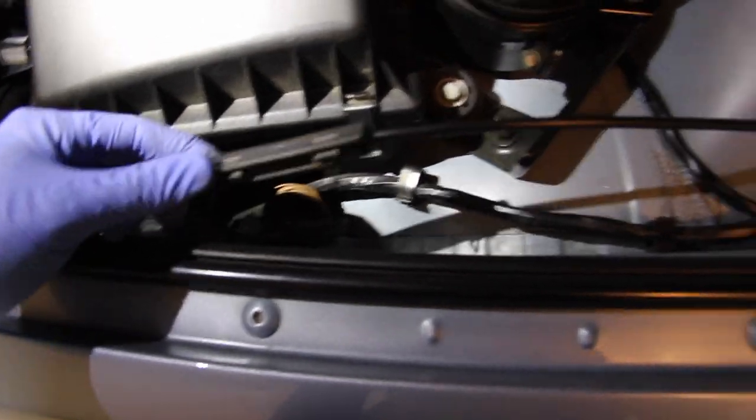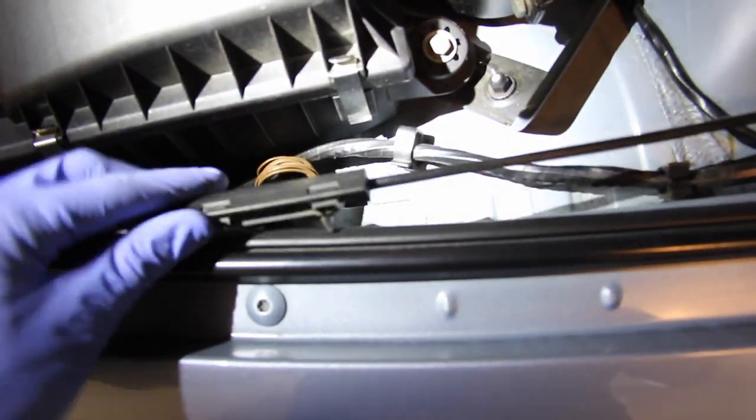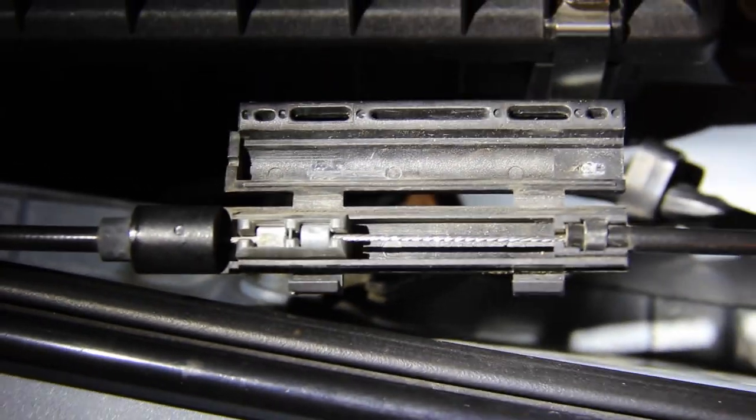Following the cable down, it pops into a clip — release it from the clip. This is the junction box; it's like a trap door that opens up and the two cables have a hammer on the end. If you're only replacing one cable, simply pull it out and release the hammer from the junction. We pushed the old cable through the firewall from the engine side using a big flathead screwdriver, then grabbed and pulled it through from the cabin side.